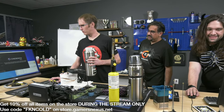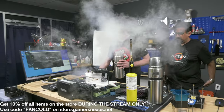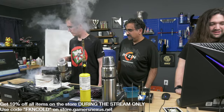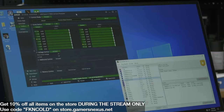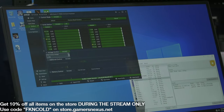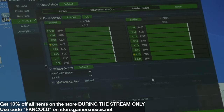I bumped up to 1.4V, we're at 6.1 GHz, at negative 150C. I think this part can bench to about negative 180C without too much fuss, but we might crash going cold here. We're up to 4,000 concurrent viewers now. At negative 170C we had an application crash - that's the same thing as before - better than a full system crash. I'll just go to 1.5V - added 100 millivolts. We're at negative 164C.